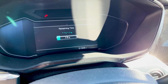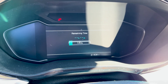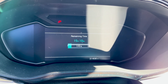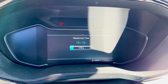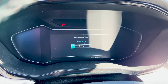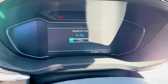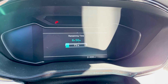I've got 86% to fill at 6 amps, and you can see on this plug-in hybrid that would take 15 hours at 6 amps, which is really, really slow. So if we bump this up to 12 amps — now I've plugged it in at 12 amps, and the remaining time for that charge is going to be 6 hours and 50 minutes, which is way, way better than what we saw with 6 amps.